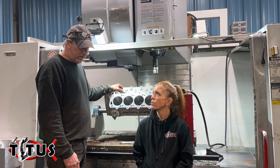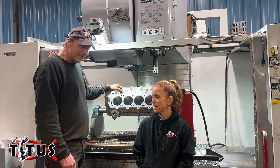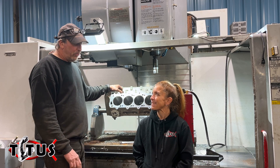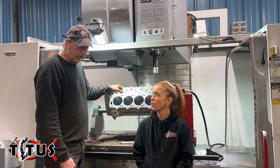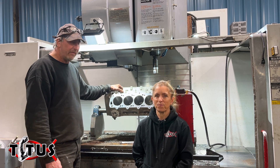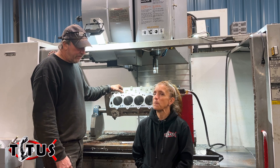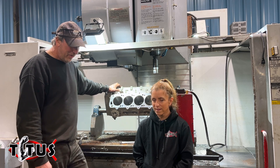As a matter of fact, I just spoke with a gentleman the other day who wanted to do some slalom and autocross. You don't want an iron block for that. The difference in weight between iron and aluminum — with a car that you want to handle like that — you definitely don't want my iron block in the front of that car. It was a '67 Mustang. It's going to nosedive and the front end is going to be in trouble before you know it.